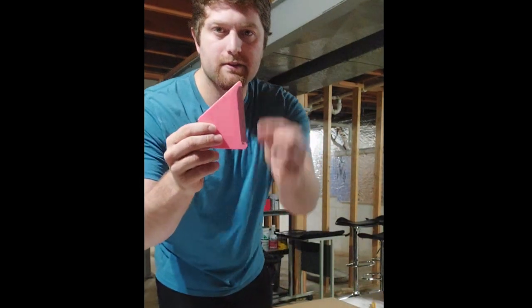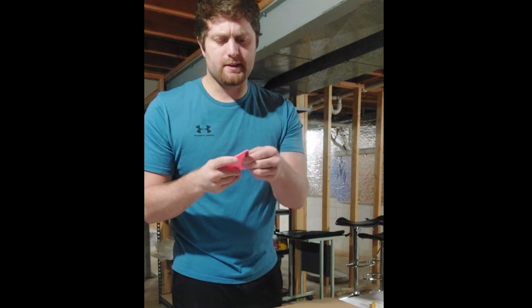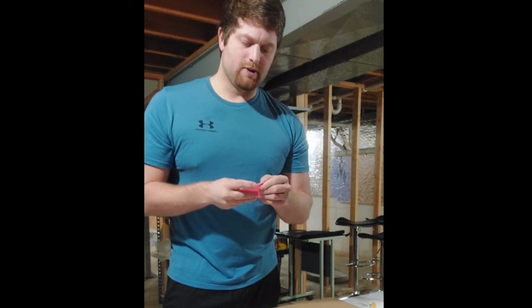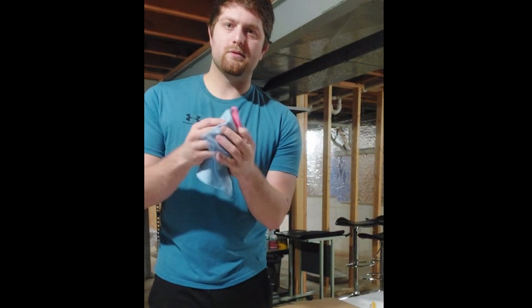One thing you'll see here is non-stick tape, or I think that's what they call it. Basically, it's really smooth tape. It's a special type you can find at tint shops. But I would recommend that once you get better at it, because it basically doesn't scratch your tint when you're pressing on it hard. Another method would be to use a cloth and use the cloth to squeegee it out.